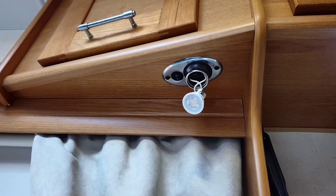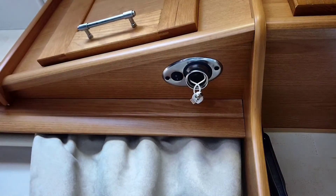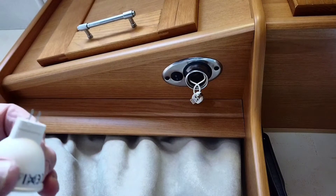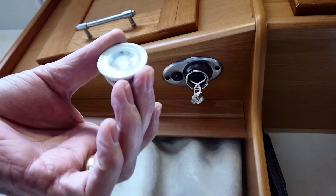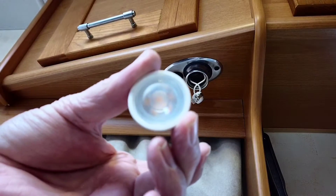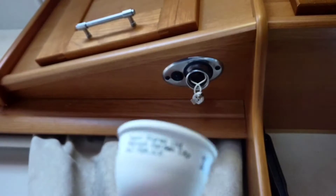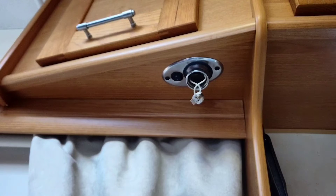Without further ado, I'll show you the ones where all I've done is change the bulbs. As you can see, these are your usual 12-volt ones, and basically all you do is pop them out. What I've got is these two pins here — there you go, that's the type that's in mine. There are different types of these, and this is the LED light I've replaced it with. They're actually from Tesco's — a 2.6 watt, 2700K, GU4.